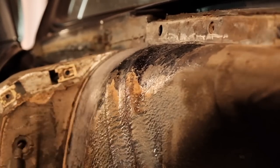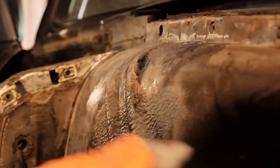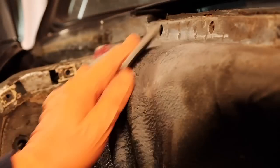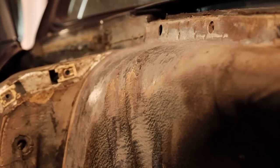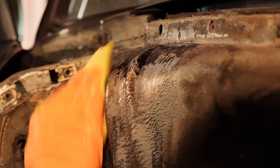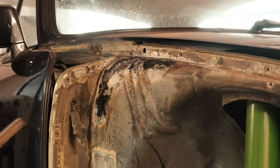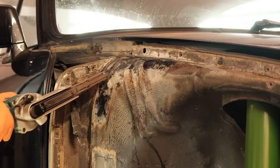It looked very good. Leveling down the surface with the sanding sponge didn't show any remainings of iron oxides. I felt the need to confirm the first impression, and at a couple of spots I sanded the converted material down to the point the naked silver steel appeared. Still no rust to be found.